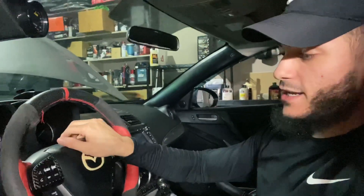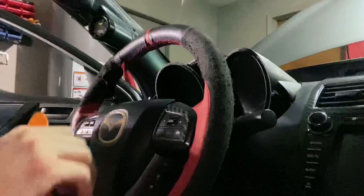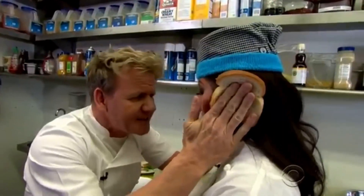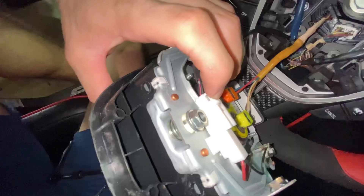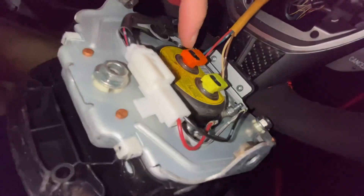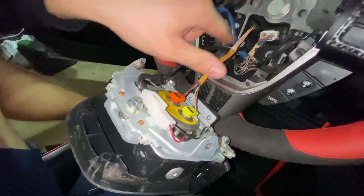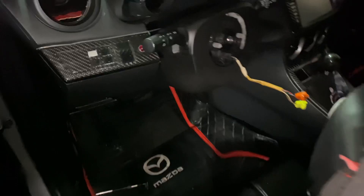So with the battery disconnected, I go ahead and take off the plastic cover right here. First time doing this, so I have no idea what to expect. You got to take the screws off first — idiot sandwich! Then this piece comes off. Take the horn button, take this clip out, drop these black tabs open, this should slide out. Same thing with these pieces — just unclip the wiring harnesses. Then you take off the 21 millimeter bolt and the steering wheel should come right off.